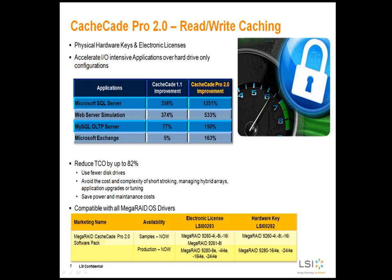And just one last thing, another big benefit is the way that a rebuild affects your I/O, or the way your I/O affects a rebuild. If you're doing a rebuild and you have eight spinning drives, you're having to access all eight of those spinning drives while you're continuing to do I/O. So you want to get your array back to an optimal state, but you can't stop I/O to do that. So your rebuild is going to take that much longer, or your I/O is going to be affected by the rebuild.